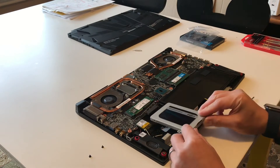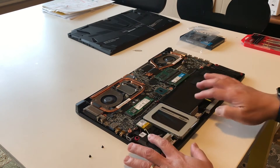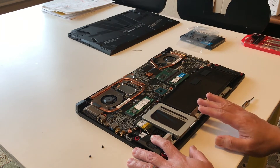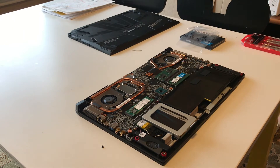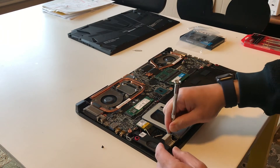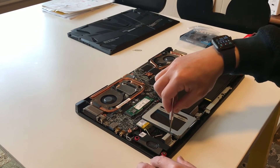Slide the drive over and make sure you don't touch any other components — just touch the plastics. Be aware of the battery as you slide it over, and you'll hear the connectors slide in perfectly. Then put in the screw into the bracket and tighten it up — now your drive is securely installed into the laptop.